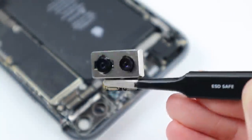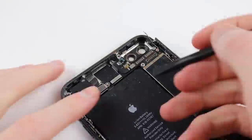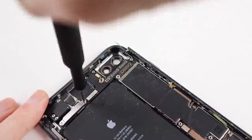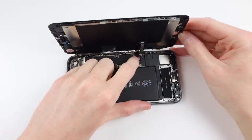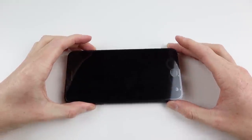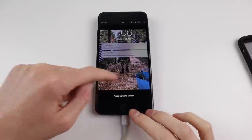The connectors all seem fine so I'm going to put that in a ziplock bag so I can make sure that doesn't get damaged. Next, I can remove this little antenna up top here which will get me better access at the logic board, and I'm just going to remove a few of these screws just to remove any tension that might be on the logic board. With that now done I can get the replacement display, install it roughly on the phone, pressing and holding the power button. I got no signs of life but connecting up a charger and holding the power button again, the phone showed the Apple logo and to my surprise booted to the lock screen.